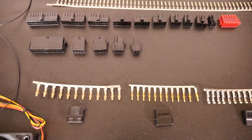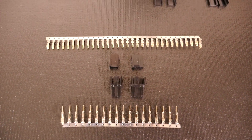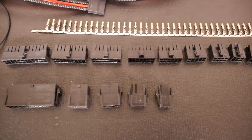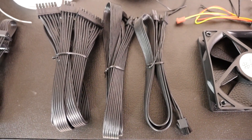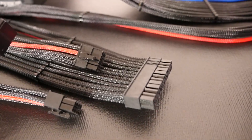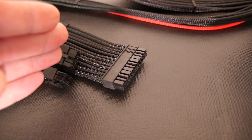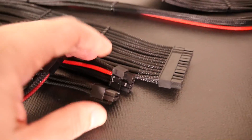Let's take a look at the pins and connectors — I'll cover these at the same time since they're very closely related. This is where the most important information lies for custom wiring components. Let's start with ATX pins, which are used for the cables for your core components: 24 pin, PCIe, EPS, and ATX. Most of you are certainly familiar with the connectors that plug into the components — for ATX pins, those plug into either your motherboard or your graphics cards: 24 pin, 8 pin PCIe, 6 pin PCIe, 8 pin EPS, and 4 pin ATX.